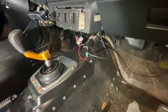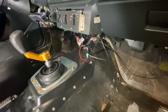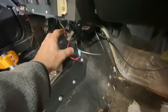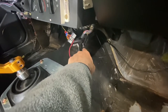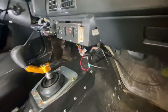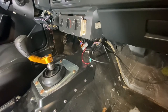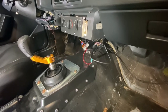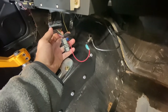Depending on whether you have premium sound, there is an additional harness under the dash. On the 87 to 92 cars, that additional harness plugs into two connectors and connects to the football amp that typically bolts to the bracket here. From there, that harness has two plugs that go into the back of the head unit. On the 87 to 92 cars, you're going to rip all of that out completely — unplug the football amp, pull it out, and unplug that intermediate harness, leaving you with just these two bare connectors.